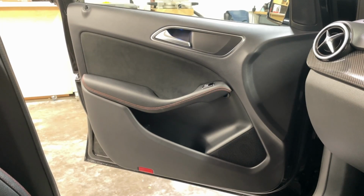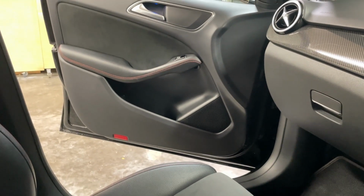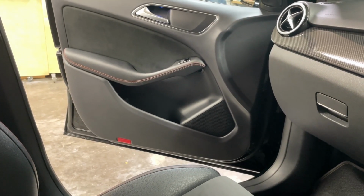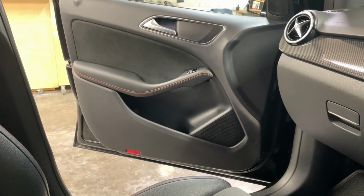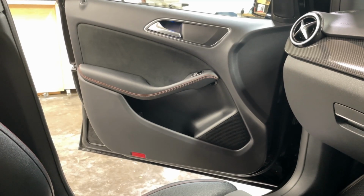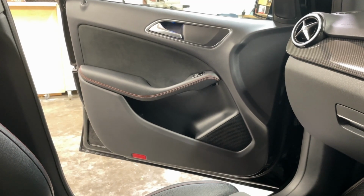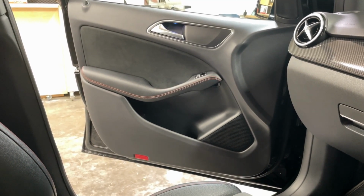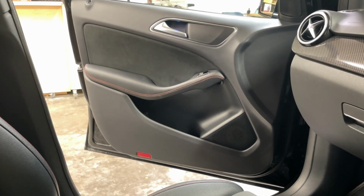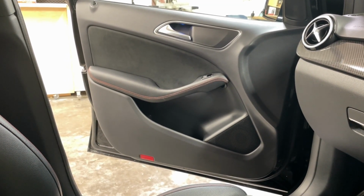It can always be taken apart, because it's crazy, you know, if someone, let's say, has the factory speaker dying for whatever reason, and someone wants to just get it changed, for even the cheapest thing costing 30-40 pounds, the labor on it can be several hundreds to get it done. For one person it's going to take way more than a day if it's done properly. Of course, many things can be butchered and screwed up, or it can be riveted back, to be fair, but it's not the right thing. When you are at that stage, you want to fit riv nuts and then bolts, and then from that point on it's always serviceable.